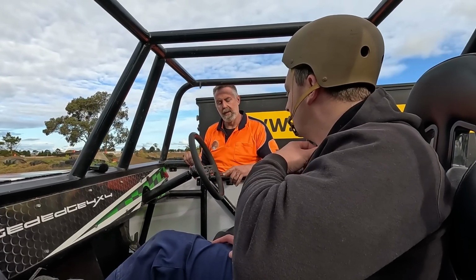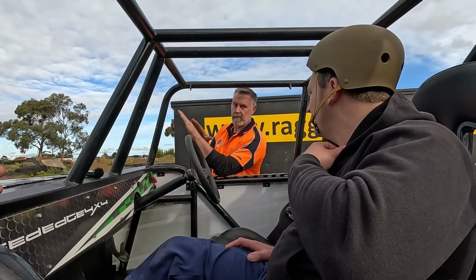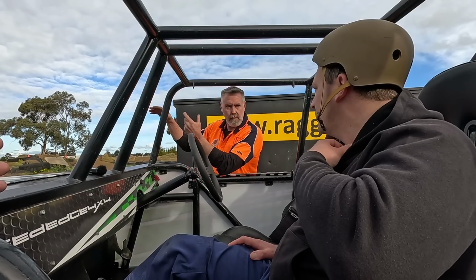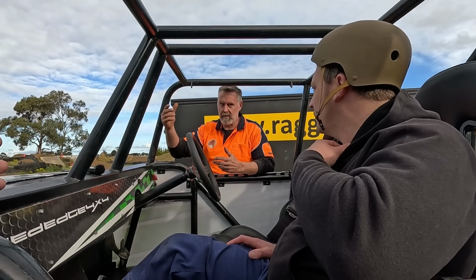The other thing is how I think about the rear steer. If you think about driving up a hill, if you crab walk at a 45, you actually halve the gradient of the hill. So more traction. For me, rather than get stuck on a hill and have to crab walk, I just crab walk up the hill. I don't get stuck in the first place.